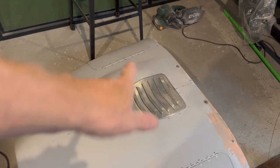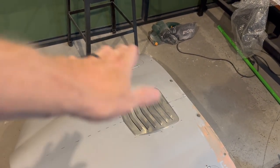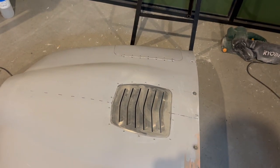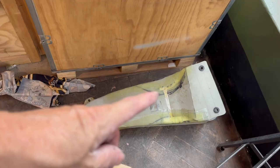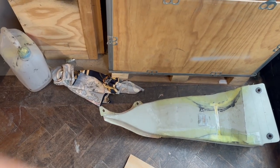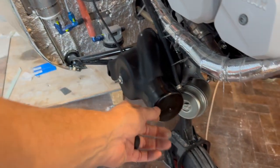695 hours and the place looks like a bomb hit it, but we're getting there. I've put the vent in on the top of the cowl using the standard rivets, and I used a bit of epoxy underneath it, although I suspect with the heat from the engine that'll be a bit of a wasted effort. Definitely making progress - that's just sitting out of the way. Still a little bit of material to put on here and down here, and just got to tidy up around the front and add a little bit of filler here and there.